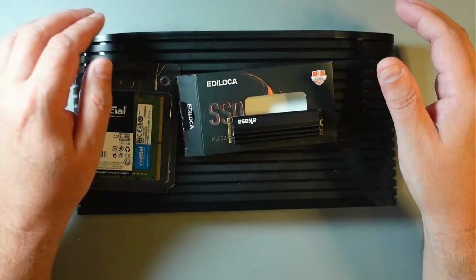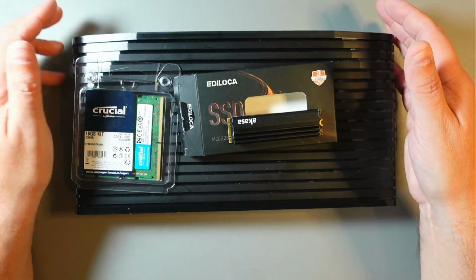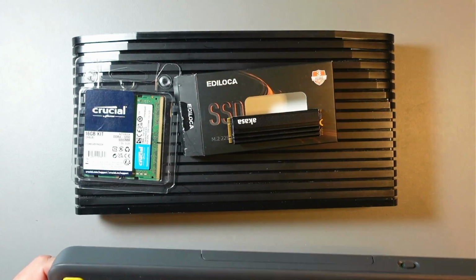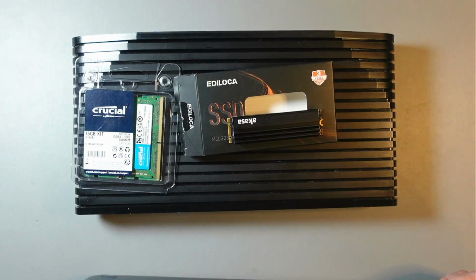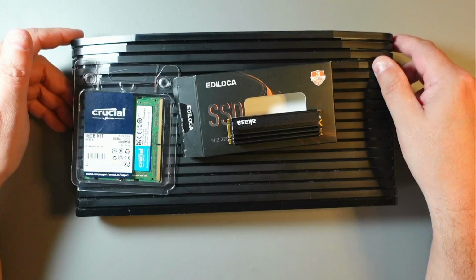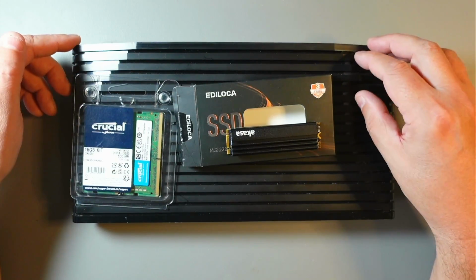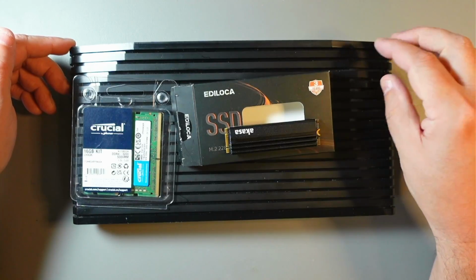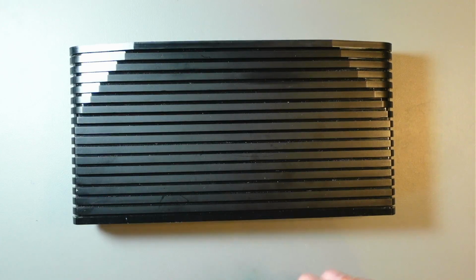So that's that. You will also need one or two USB flash drives and a screwdriver. And you'll probably need a keyboard, and I'm using this Logitech one. You'll need either a wired keyboard or one that comes with a dongle. A Bluetooth keyboard won't work for this particular task, because we'll need access to the BIOS. I'll show you when I'm entering the BIOS. You may need to downgrade the BIOS, and I'll put the links and the BIOS in the description, so you can do that. But first things first, let's go ahead and open it up.